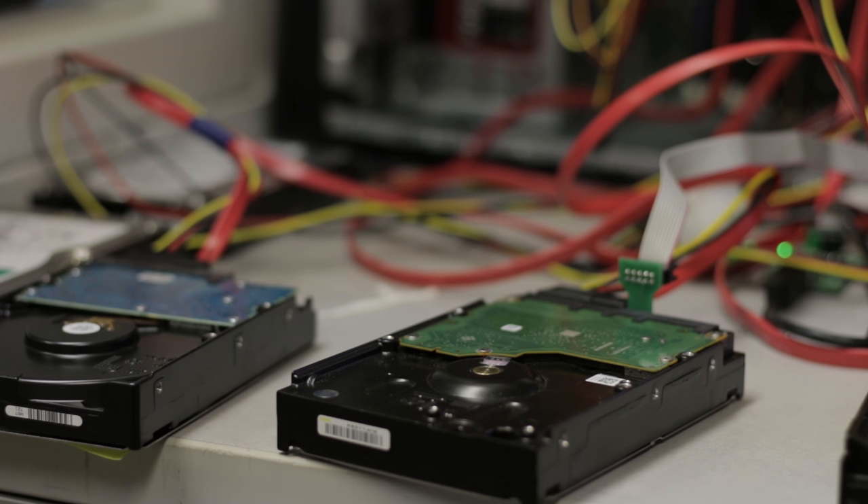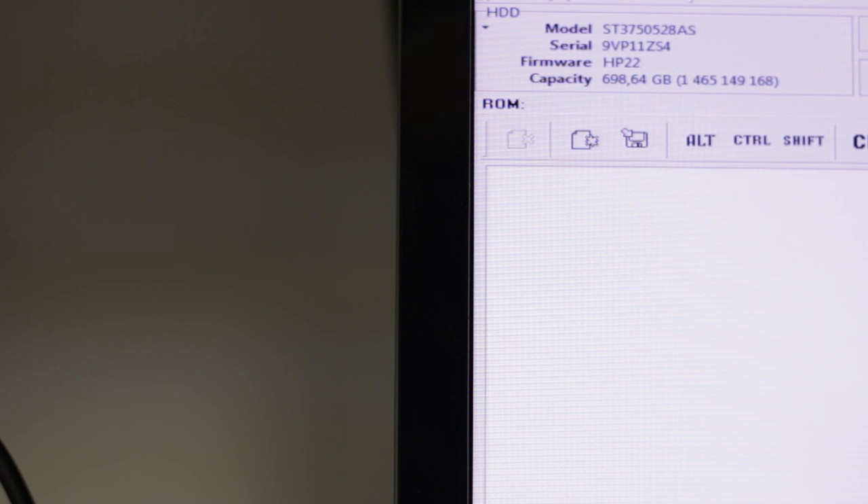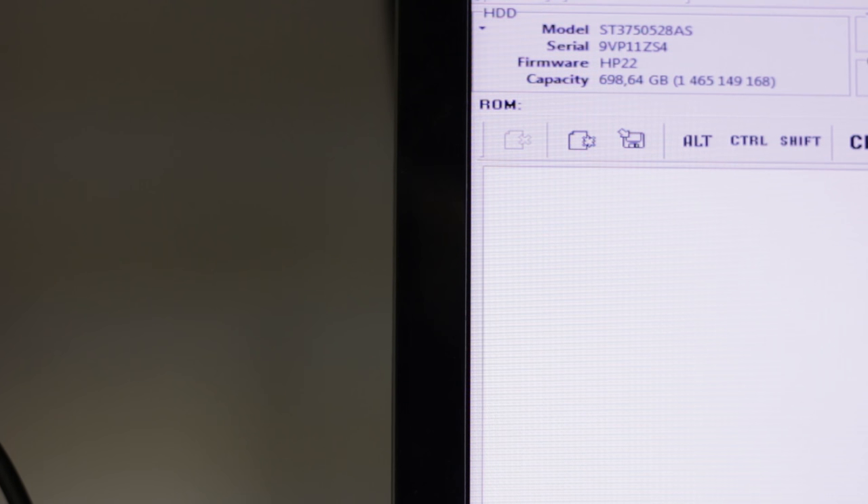So I just got the drive hooked up and turned on. It clicked about 30 seconds or so after the head swap — on these drives that's a fairly normal thing for them to do. It's an indication that the drive actually gave us proper ID, serial number, firmware, and capacity. That information is kept on the platter surface, which means those heads that we've inserted were able to read.